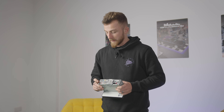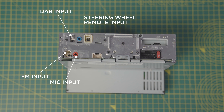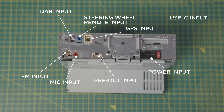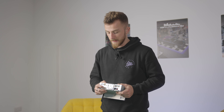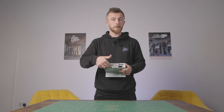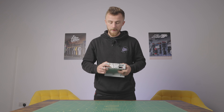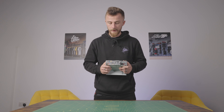On the back of the unit, we'll go through the connections quickly. So here we have the FM input plug, microphone input, DAB input, steering wheel remote input, GPS input, pre-out input, power loom input, and USB input. The main difference from other Sony units to make it shallower is the pre-out input plug — most of the time you'd plug your RCAs directly into the back of the stereo, but this has been done on a separate loom plug, which just makes it a lot shallower.